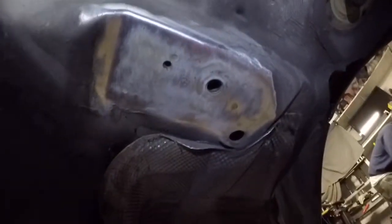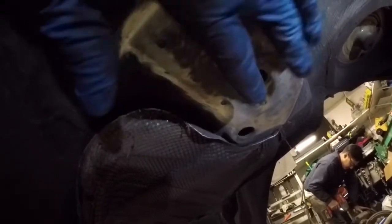Here's how the plates fit — they go like this, right there. See the two holes aligned with the two holes? There's a hole here and a hole there. That's where they're set up to go, so it holds everything together and pulls the upper layer inside down along with it. We're going to weld it all the way around 360 degrees, plus the welds in through the center holes, to hold it flat, and then put the subframe back up.